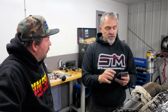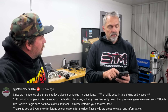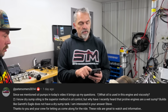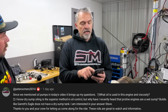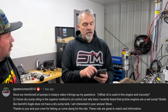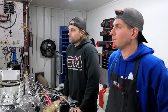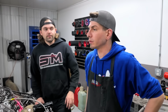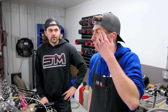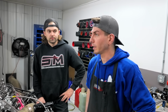But let's get to the other question that I thought was interesting. I know dry sump oiling is a superior method of oil control, but I have recently heard that Proline engines are a wet sump. Builds like Garrett's Eagle do not have a dry sump tank. I'm interested in your answer, Steve. Do we know what's going on there in the Hemi engines? What is going on with the oil pump? I'd have to see it to know what they're asking, but is it a hybrid dry sump where it uses a dry sump pump, but the oil remains in the pan?